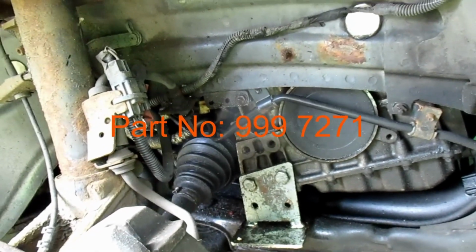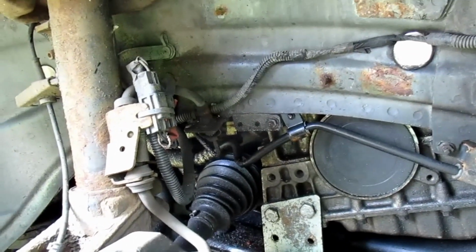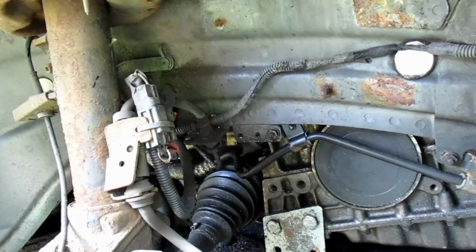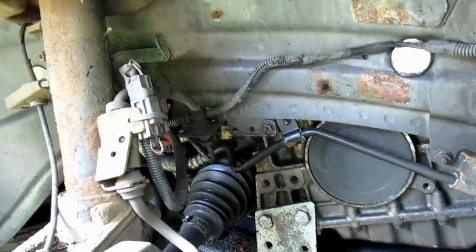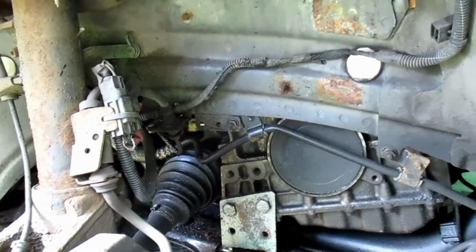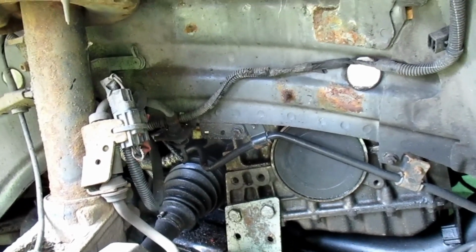The circular plastic cover, the crank end cover there, needs to be removed so that I can put in a locking device. And before I can do that, I've got to shift that pipe. The pipe is a feed pipe from the power steering system. I don't need to disconnect it, I just need to move it, unbolt it, or move it to one side I should say.